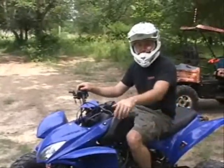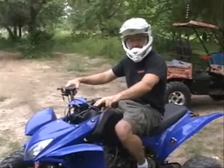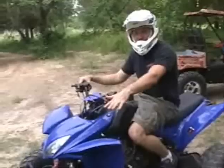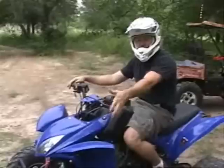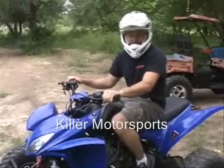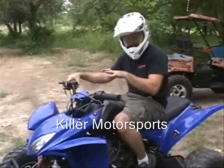You can check out some of my other videos about the speed throttle and how to adjust those. If you have your weight centered about where I'm at right now and you're not just giving it full gas, it's going to be pretty manageable. When you have a 300 like this, it's got more power and the chances of popping wheelies is a lot higher. The clutch is basically your power control for the ATV — you can press the gas full in all you want, but if the clutch is in, it's not going anywhere. If you have the clutch out, it's full power. So understand that the clutch controls how much power the throttle is letting the ATV move forward.